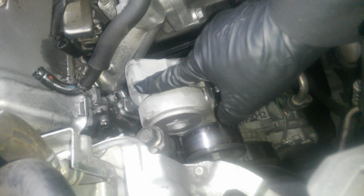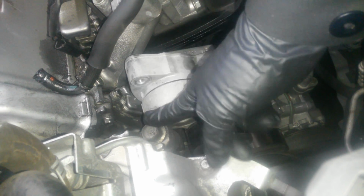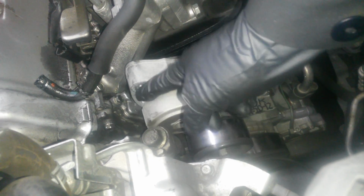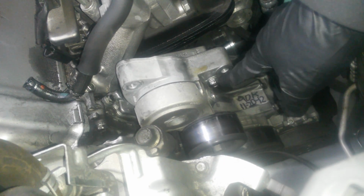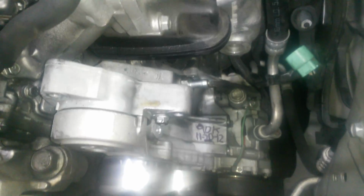You're looking at the back side of it here. The bolt was coming out the front end, and then here's the other one. Those are only two bolts on the pump, and the pump is out of your way. Both of those bolts, one comes here, and the clearance in between the back of this nut and that bolt with the ratchet is not enough. So you need the gear wrench instead of a ratchet wrench. And then the other one goes here. And then I always put date and mileage on them.